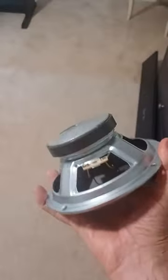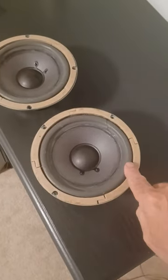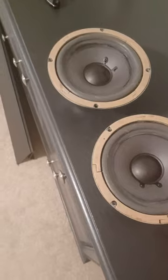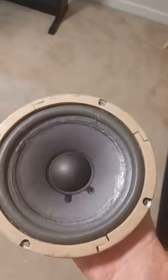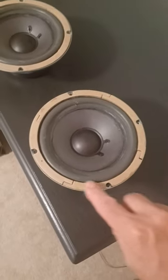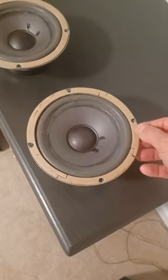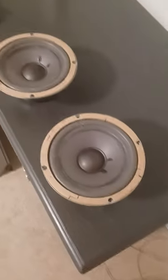The speakers were rattling. I finally got this apart and removed the speakers. The speakers are a Technics speaker — these are the speakers — and they're no longer available. What was going on, at least what I thought, was the foam on these had deteriorated. So I bought a kit to repair those and re-foamed them. I thought I did a pretty nice job — good contact everywhere. I had to remove these phenolic concave washers, four pieces, and then re-glue those back down. I thought I had a good job.